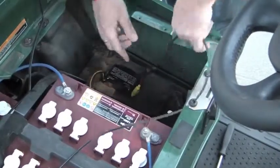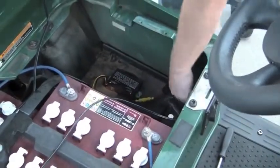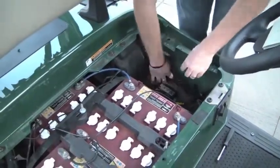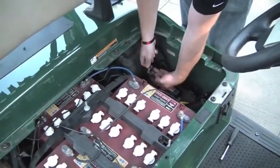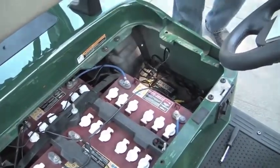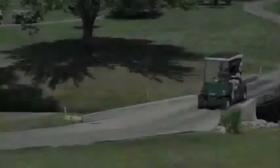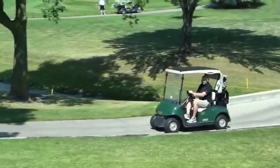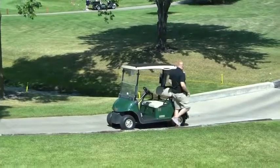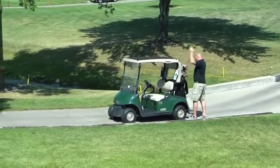Connect the O-ring cable to the charge controller, then connect the extension cable from the solar panel to the other end of the charge controller. Replace the seat on your golf cart and you are finished. Take your cart out and enjoy the extra driving range and battery life the PowerFilm Solar Golf Top brings to you with a little help from the sun.